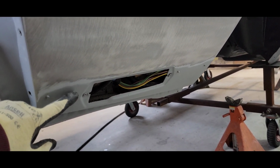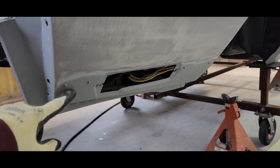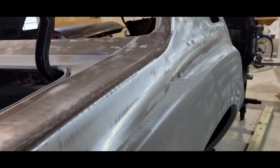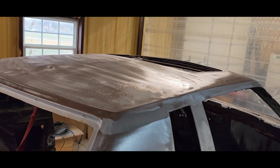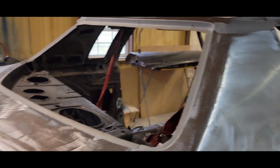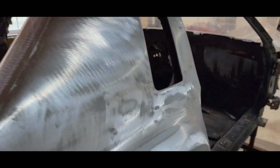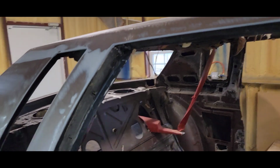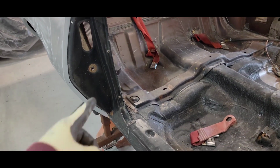I hit this down here. I didn't want to grind off my pins, so I'm going to put this chrome back on the bottom. So I hit that with the DA, cleaned all that up in the fender wells. So she's ready. We're going to hit all this with 80 grit on the DA, smooth it all out. Once it's all ready and stripped inside the window channel, these door jambs, I'm going to clean them out real good today. If it doesn't get too cold too fast, we're going to go ahead and clean all this out. We're going to strip all this.